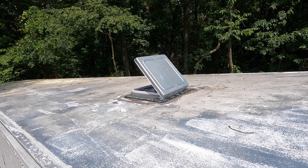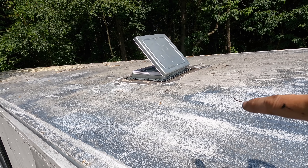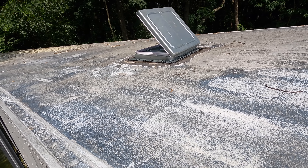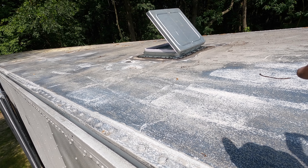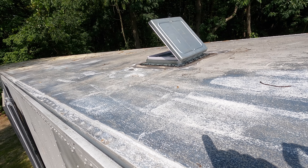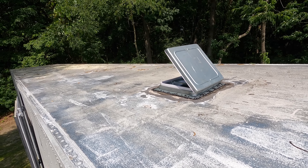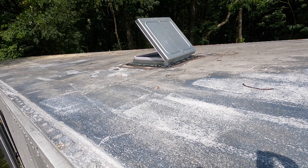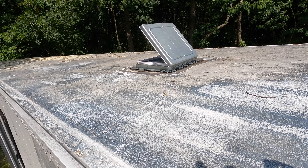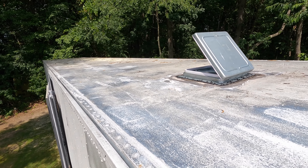One of the roof vents is back in business. I ended up opening the vent, got all the rivets in up here, and went ahead and siliconed the crap out of them — so that should be good. I'll probably smooth that out a little bit, and then when we seal the roof, we'll seal right up to the flange there so no water is getting in. As a bonus, it's a little bit lighter in there now whenever I open that vent, and we can help get some of that hot air out when we're working inside.